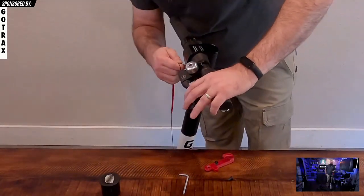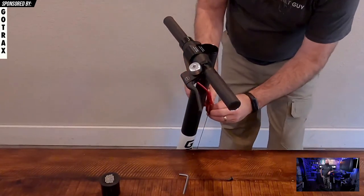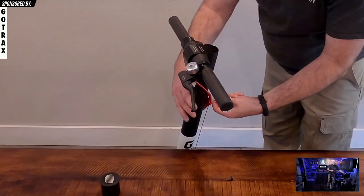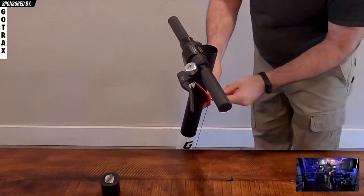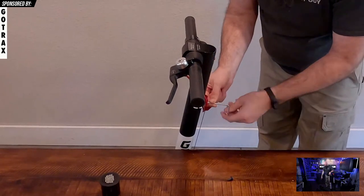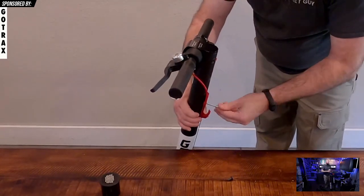You're going to connect the brakes. If you've ever worked on a bicycle, really, really simple. Pull the handbrake down, you add the little end through there, and then you add it to this. And that's going to tension your brakes up. Now, you can adjust the brakes. It does have electronically assisted braking on this. I need to point that out. What does that mean? Well, when you're hitting the brake, it's actually using the electric motor to slow you down first, and then it's going to be using the disc brake. So if you're not getting the braking that you want, make sure to calibrate those brakes by adjusting, and it's in the manual, adjust that back brake cable, and it's going to be great.